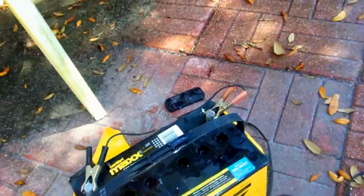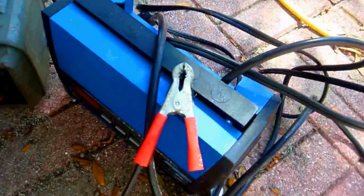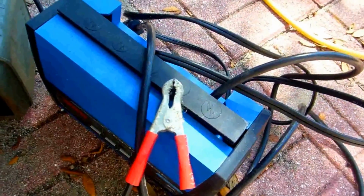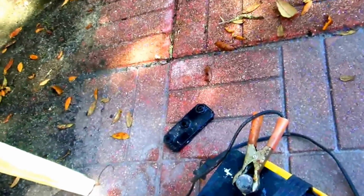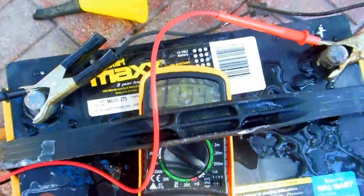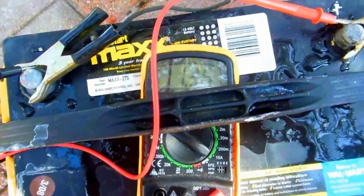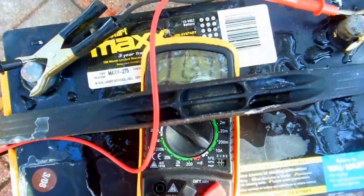It was at 10.8 volts, and I'm going to put this one on here, this Ship to Shore Schumacher one. It's an electronic one, but electronic ones aren't good to get something going when they're completely dead. Let's see if I can hold this on here. Yeah, you can watch the gauge. It's been going up. See? Well, slowly. It's taking a charge.